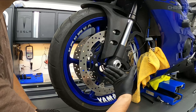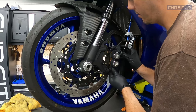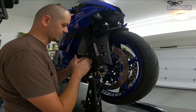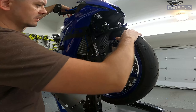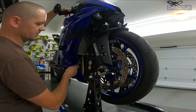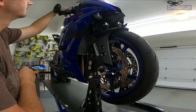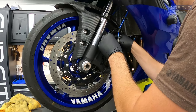With pinch bolts tight, reinstall the calipers. Make sure the brake pads are in the right spot, line it up with the rotor, slide it in nicely, and put the two bolts in. I leave the caliper bolts fairly loose at first — I like to spin the wheel and squeeze the front brake to seat the brake pads to the rotors, then while holding the brake I tighten the bolts down. Do the same on the other side. The last bolt is for the bracket, with a washer on the back end and the nut.